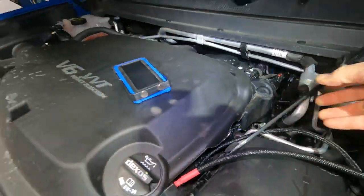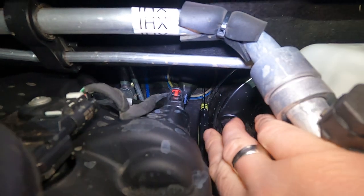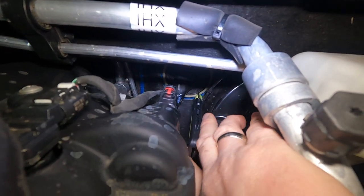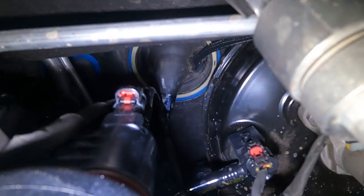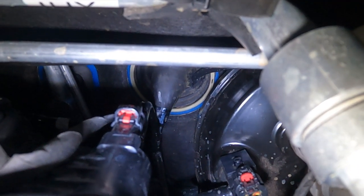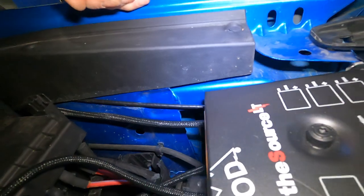Up next is putting the ethernet cable from the engine bay into the driver's compartment. I attached the ethernet cable to this little plastic fitting, then got a fillet knife for fishing and cut a hole in that little rubber grommet on the driver's side. I was able to get my big hands up through there and fished the ethernet cable through the side of the truck.